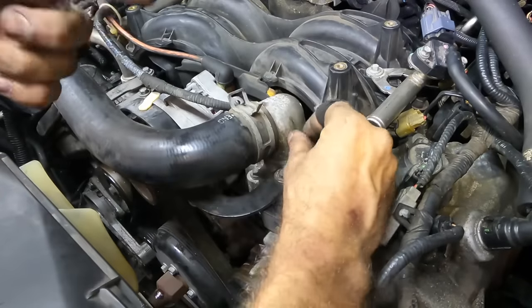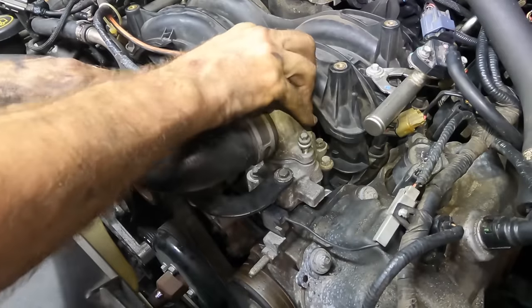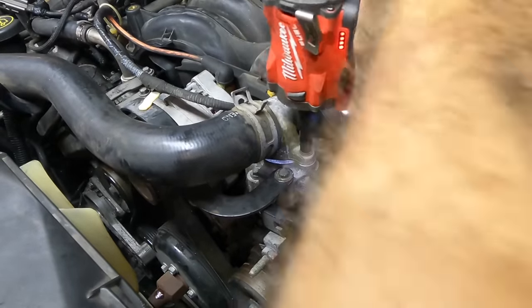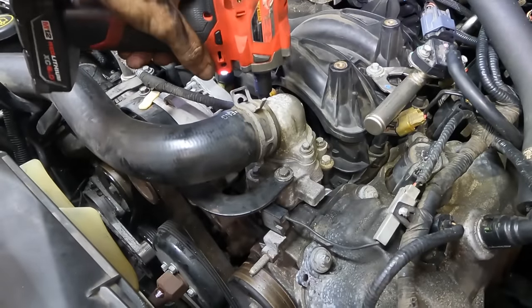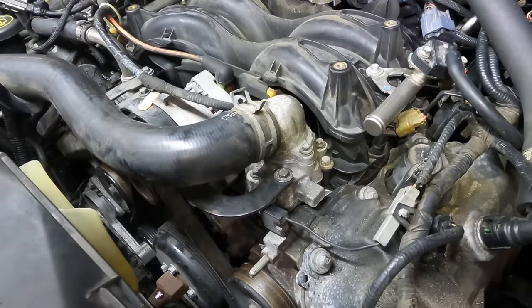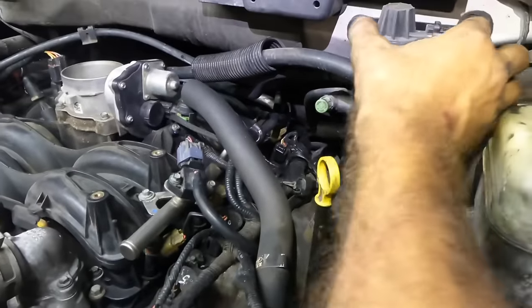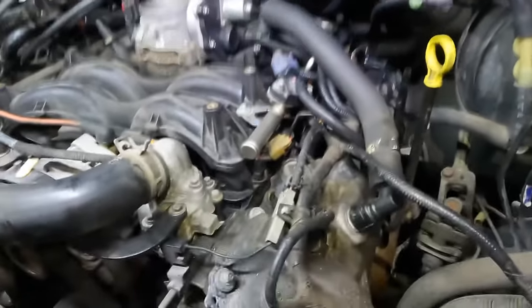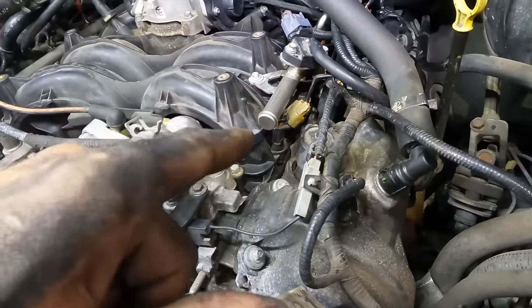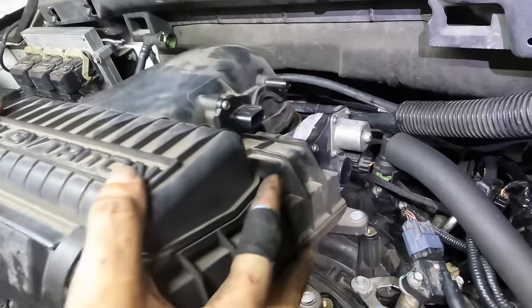So we've got the belt on. Injectors connected, hoses connected, alternator on, connected, those are all accounted for. We have to put another fuse in it because the one fuse is still blown, and I've got to throw the intake on, connect the battery. We also have to connect that evap solenoid. We've got to connect the AC compressor because that's still disconnected from the diagnosis, and we've got to connect the purge valve out back. So there's still a few things to do, but we are in the home stretch, which is good. We like it there.